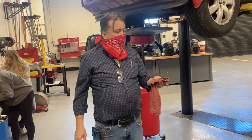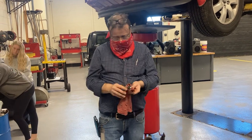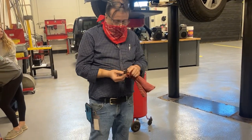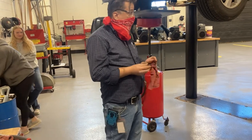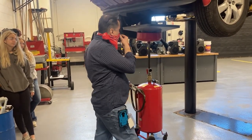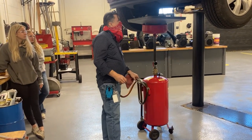Okay. So, the condition of the hex that you stuck the 6-point socket on is good. You look here at the seal and it's in good condition. You look at the threads and they are in good condition. This is the time that you let Mr. Kozler or myself know if you have an issue with that. Okay.